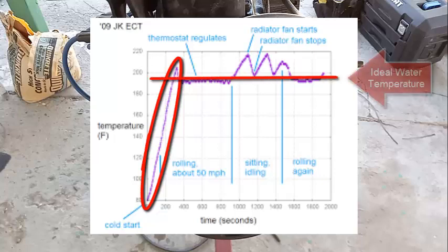What is the purpose of a thermostat? The engine works most efficiently at a certain temperature — it pollutes less and gets more miles to the gallon. What you want is to get the engine to that ideal temperature as fast as possible. That's why when you start the engine in the morning, the thermostat is closed and the water just circulates.